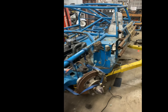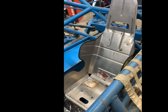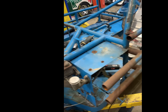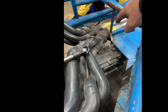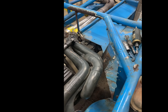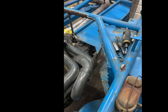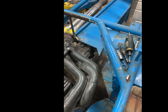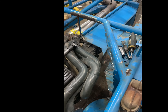Welcome back YouTube — the sparks have been flying! We got the seat mounted using the existing seat mounts. Now we'll work on this firewall — I've come here and cut all this to make it nice, neat, and square. We'll build a template and figure out how to plate it back in. I'm going to use thin flat sheet metal, weld it in — it's going to be a little tricky with some combination corners here, but I think we can work with it. We'll make a cardboard pattern first.